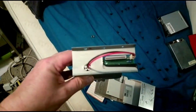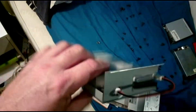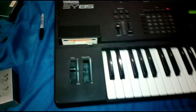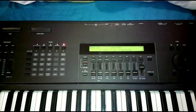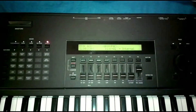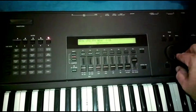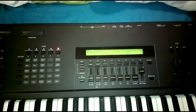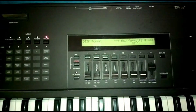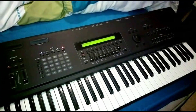We've had to do a couple of modifications to the metal piece — I've had to cut a slot because of the extra board on the back, and drilled a hole to make it easier for the power lead to go in. It should fit in perfectly now. That's the Sony one — the Panasonic didn't seem to work. Loading the Groove Factory... there we have it, it's just said 'completed' — Groove Factory! Now take the disc out, grab a blank disc, stick it in. Easiest way is to go to menu, number 10, format, press yes — and there we go, up to 87... completed! Amazing. Another formatted disc — the SY85 seems to be back in working order.